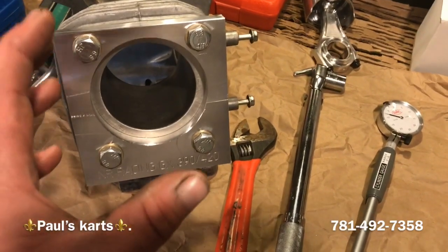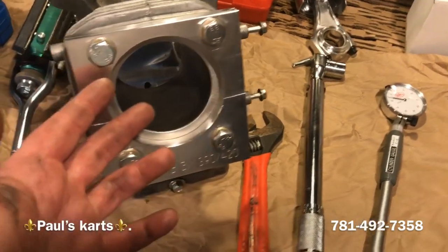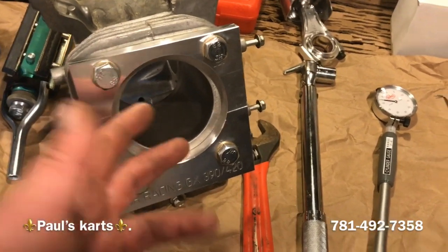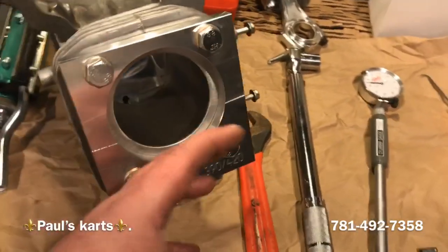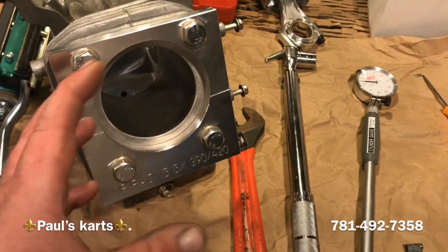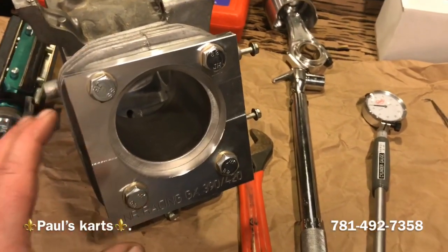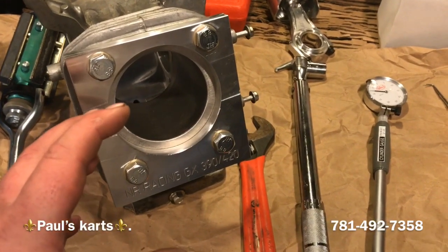For racing, you definitely want to have the straightest bore. If your bore is shaped like a football — like in this case with this old block — what that does is it causes ring flutter. This block is all over the place: four-thousandths here, six-thousandths there, seven-thousandths up here. It was due. So we're going to bring it back to a true size with a torque plate and a rigid hone, dress the stones on the hone, and then get started on this.